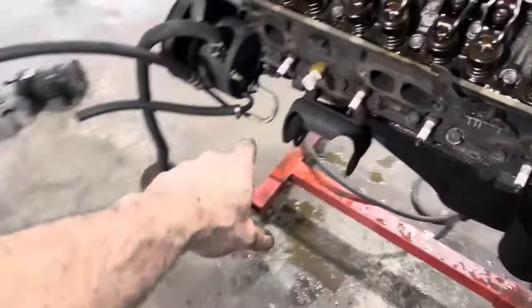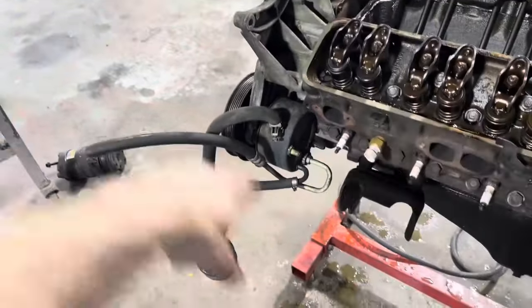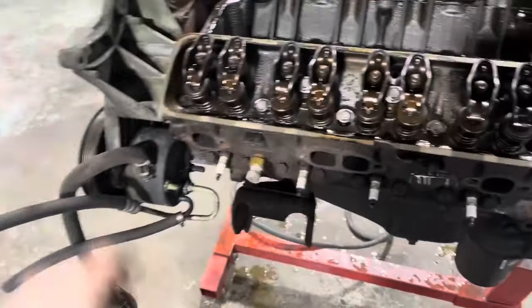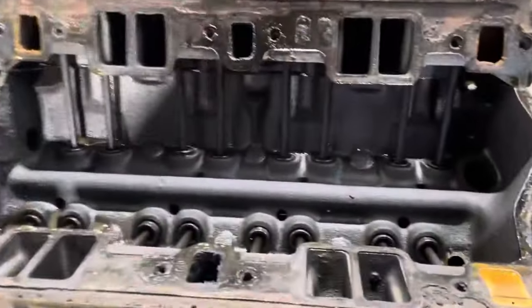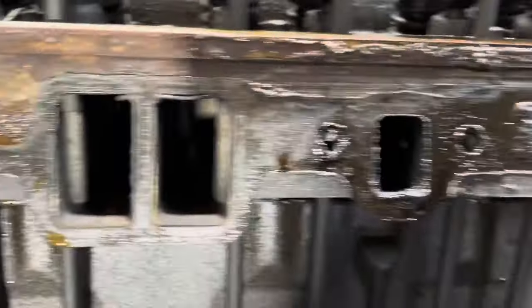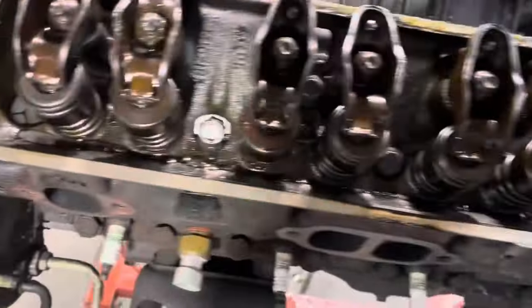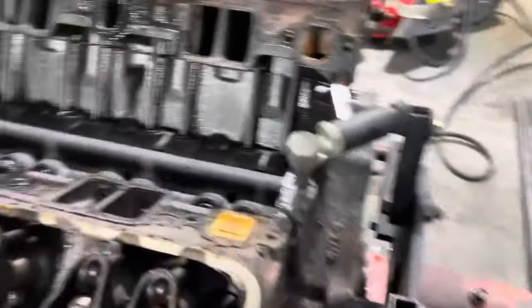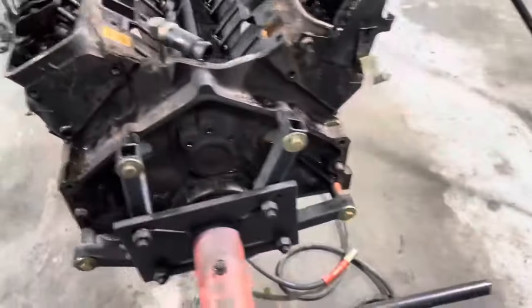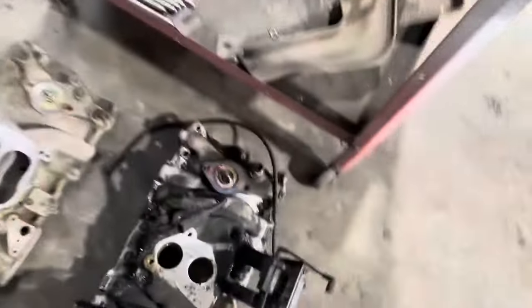Okay, that is as far down as it's going. I'll pull my power steering hoses off here and just transplant the hoses from there onto here. All the rest of it's staying. We're just going to clean this up, put the intake on it. Motor looks good inside — kind of like I knew it would. Ports are clean. No sludge at all in the heads. A little water in there from power washing, but we'll get that out of there. We're going to slap this puppy on here.